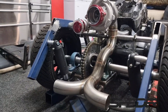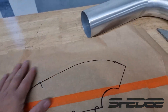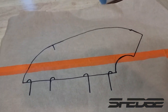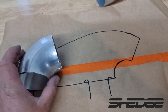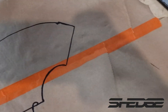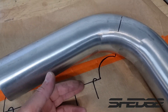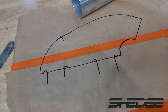Now that the downpipe is done, we're up to the plenum. Here's the rough idea - we've done all the measurements underneath and overlaid and traced it out so you can visually see it. Obviously we have some trumpets in there, and it's going to use some three-inch tube and flat sheet to make up the shape. It looks a lot bigger than it really is. We'll cut it in half and use sheet to make up the flat side. The volume should be well over one-and-a-half times the engine capacity, so it should work out quite well.